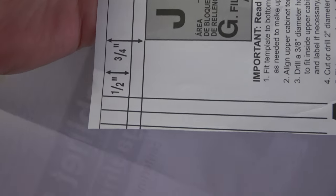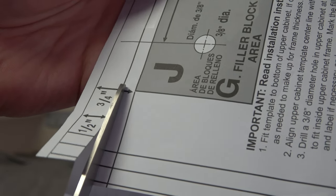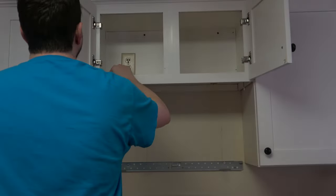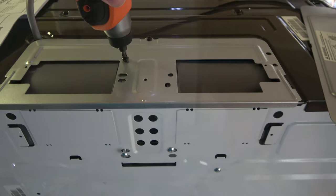Read the upper cabinet template, cut and tape it onto the upper cabinet. For my setup I needed the half-inch trim, so I trimmed all along the template. Mark the holes with a pencil and drill if needed — by some miracle my two holes were already aligned with the pre-drilled screws in my upper cabinet. Next, access the fan motor if needed and make sure your exhaust setup is configured correctly. I pulled the motor out to confirm it's set up to recirculate.